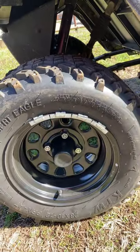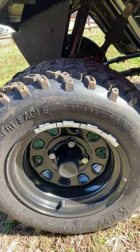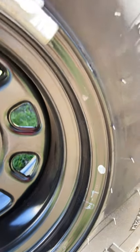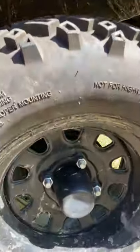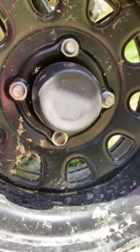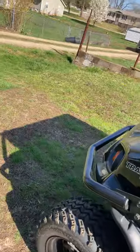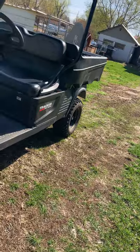When I went to pick the OX up, the gentleman was nice enough to load it up for me. This is how I got it back: this was originally the left rear tire — you can see 'LR' with a big white dot, weights on the outside, and a single huge weight on the inside. Mind you, this is a small wheel and tire on the left rear side. I highlighted one of the studs with black permanent marker so I knew where to put it back. That indicates to me that's where the warped axle was, so they put all that counterweight on there to try and eliminate the issue.